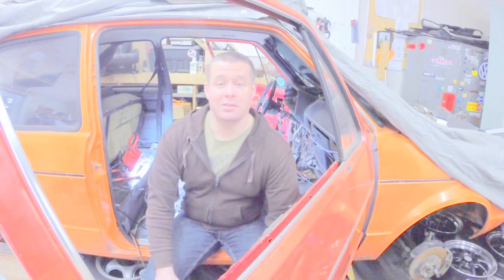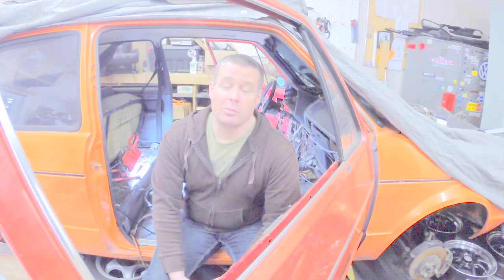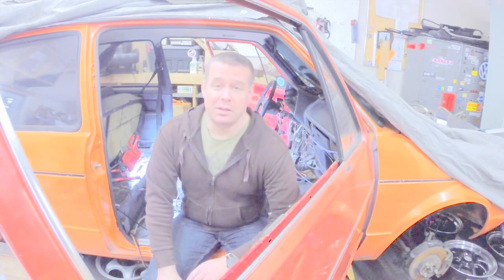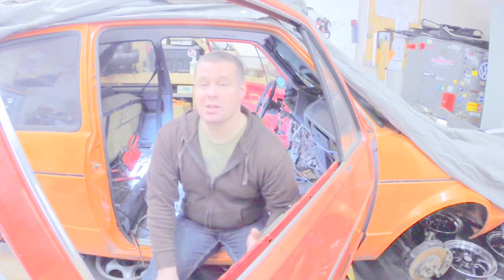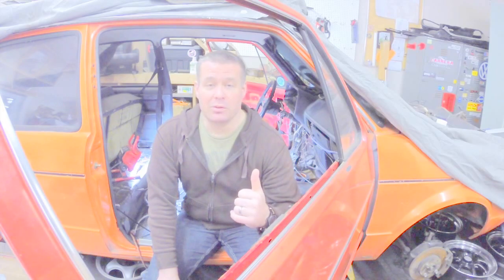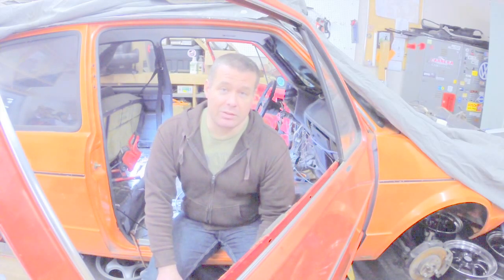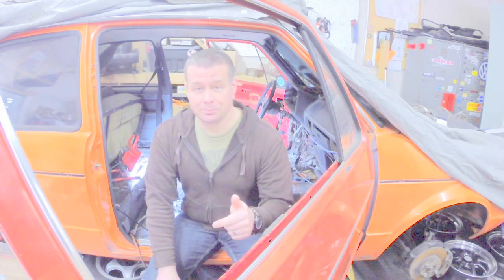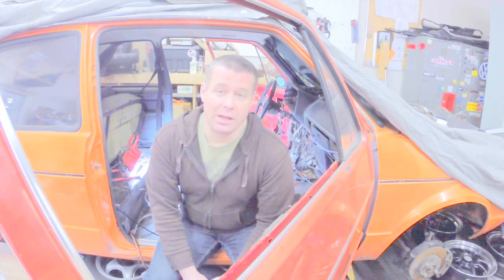But we're back. Today we're going to get the driver's seat set into the car, and then we're going to double check where our seat mounting holes are going to be. We did some math the last time we filmed and put all our marks in. But this time we're going to put the seat in the car, double check where our marks are, see that everything lines up, then we'll pull the brackets out, tack some bolts into there like we did with the passenger seat, and put them back in the car, and then we'll tack them in place. So let's get to it.